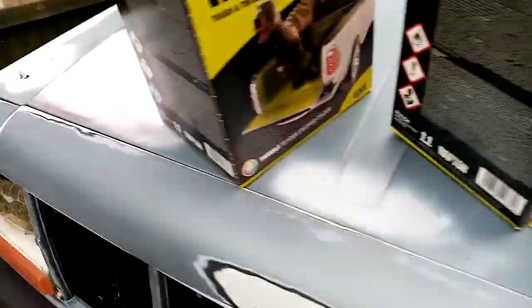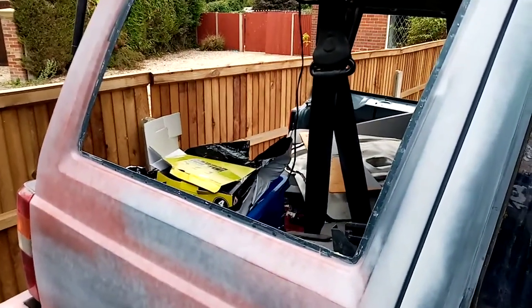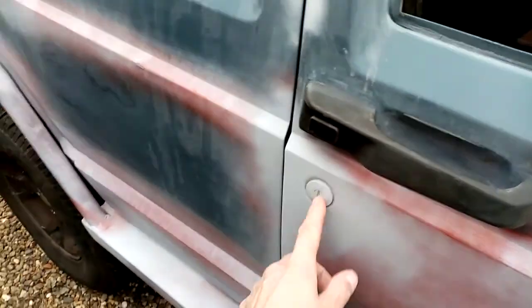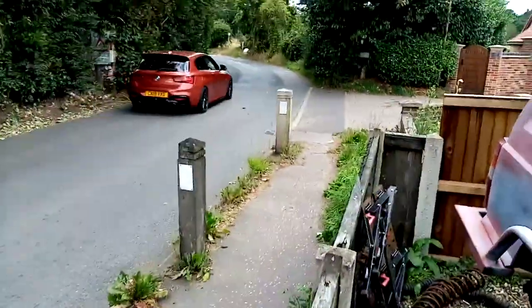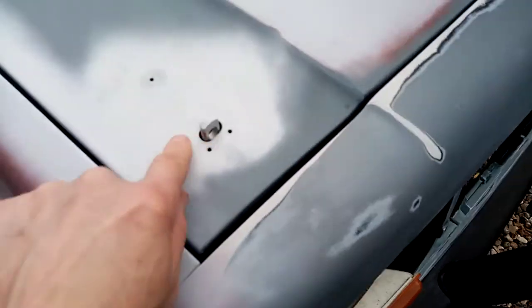What I've done all around the Jeep is the whole thing has been completely etched up, primed up, and I've removed windows where I can — the side windows just pop out. I'll remove all the trim so I don't want anything coming up. I will loosen the handles off when I get to the paint shop. I'm going to drive it to the paint shop like this. The Grip 4 is used in areas like this — I will spray it up all down here, in here, and down here, and literally just any little screw holes.